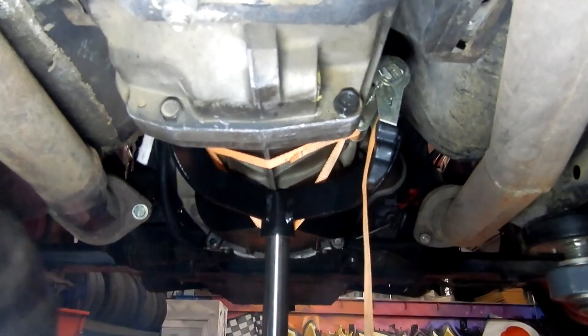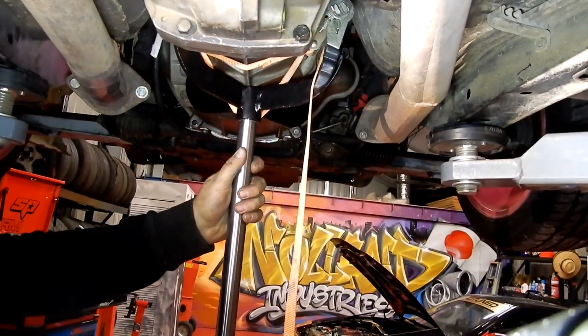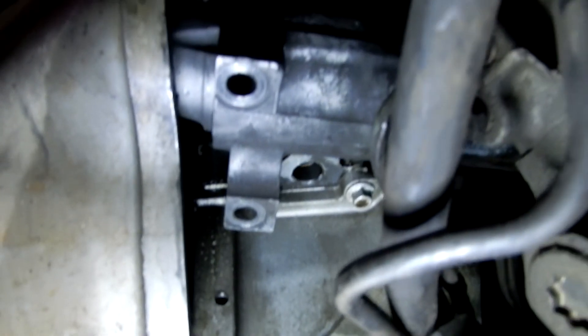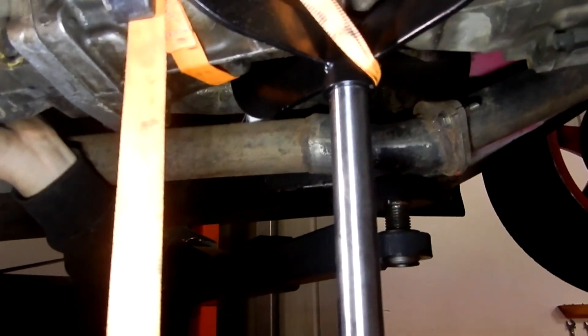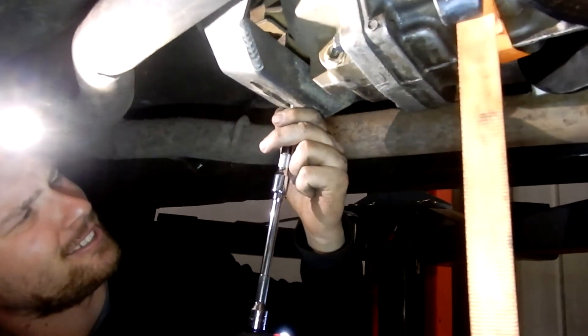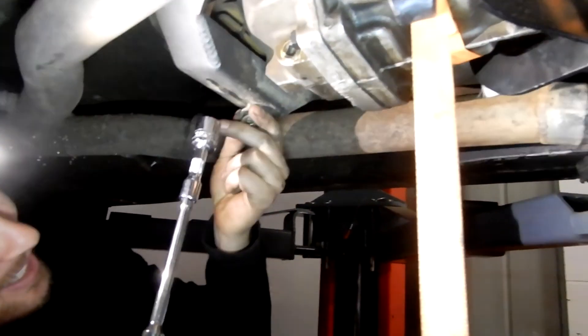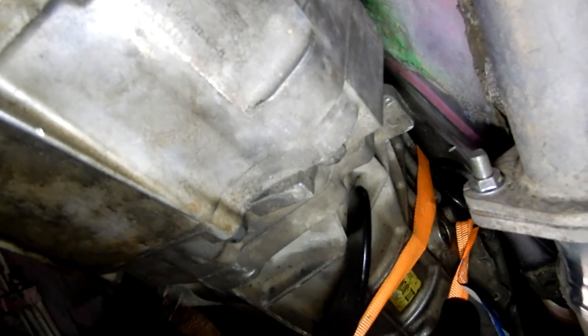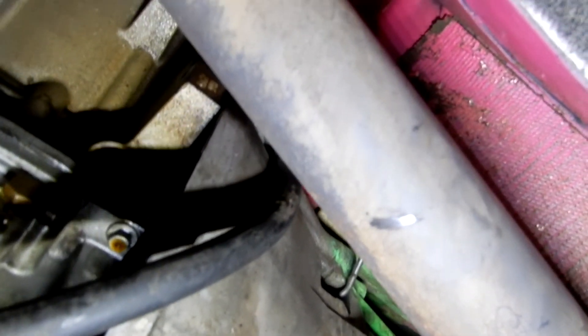We're just taking the last couple of bolts out. The first thing we did was drop the oil out of the gearbox, take the gear knob off and disconnect the battery, because we also took the starter motor out. On this T56 gearbox there's just two bolts underneath the starter motor and it slides right out — it's a dream, the RV one's pretty shithouse. We're about to find out what the go is with the clutch. Still need to disconnect the hydraulic line from the top — should have done that first. There's also a shitload of oil leaking from the rocker cover — we'll have to deal with that.